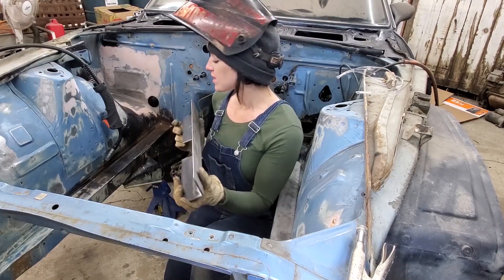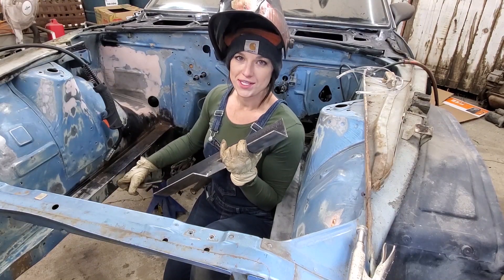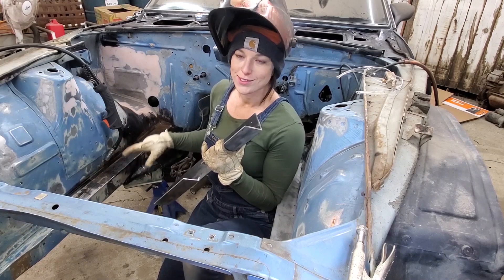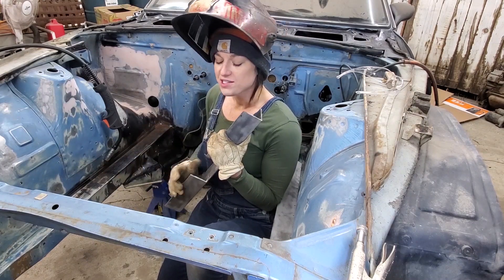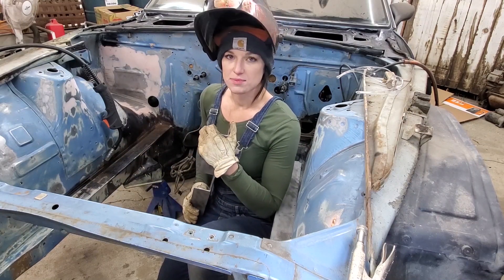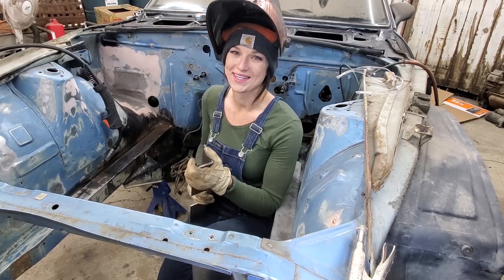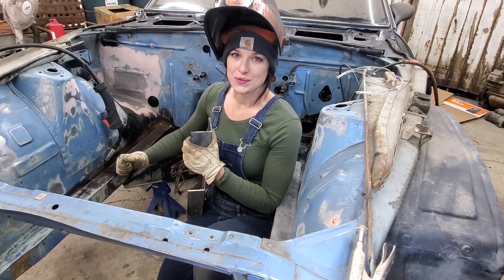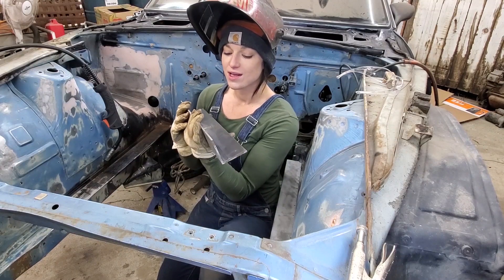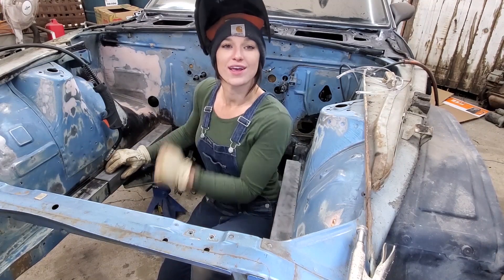I'm gonna be welding in these angle pieces along the frame rails. These are gonna be a reinforcement for that factory frame rail because it's really thin steel and it's had some rust on it. We're gonna be attaching engine mounts to the frame. The factory engine mounts were on the crossmember and we could have reused those with some of the aftermarket engine mounts for the LS, but they got in the way of AC. And I really wanted AC. So we're moving them to the frame rail. Nick milled down the radius of the angle really nice, and I cut out the suspension, so we have a nice tight fit on both sides. And we'll get to welding.